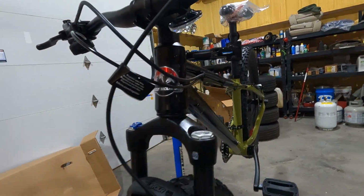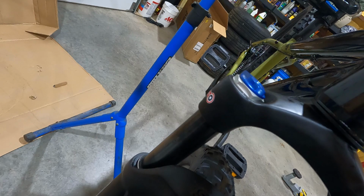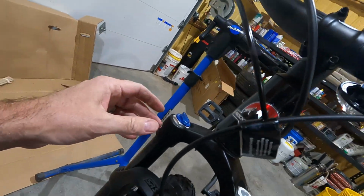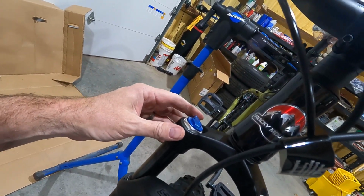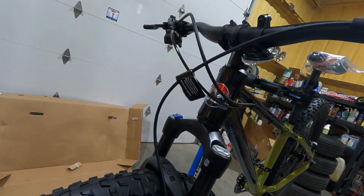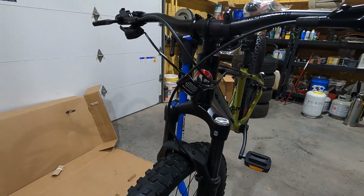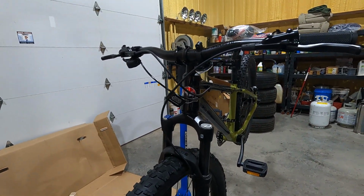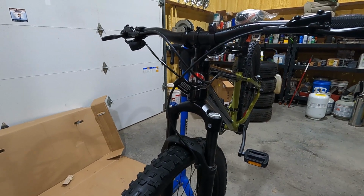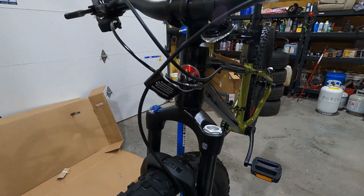Now, most mountain bike, this, by the way, this is the lockout, so you can lock it out so it doesn't work. And you know, there are scenarios where you might want that, like you're riding on pavement or something, you don't want the suspension absorbing your pedaling power. So anyway, we're gonna leave it open. Most of your mountain bike shocks you'll need a pump that's special for the shocks. And you know what's special about the pump? Well, it's a small piston, so it doesn't move a large volume of air, but you can hit higher pressures, up over 150, 200 psi if you need to.